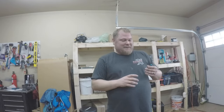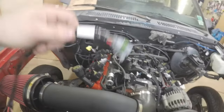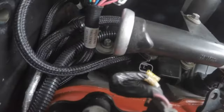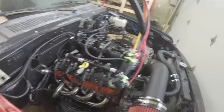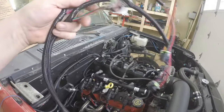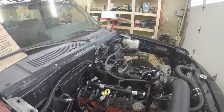This is the last piece of the puzzle - I'm going to throw the last injector in the fuel rail, put the fuel rail on, push the truck outside, go through the wizard on the Holley, and then turn that key. I'm really stoked. Let me get the injector harness on - it plugs in here on the main harness where it says 'IN.' On the little injectors it has the cylinder numbers, so it's very important that the cylinders are correct. Cylinder 1, 3, 5, 7 on the driver's side, 2, 4, 6, 8 on the passenger side.